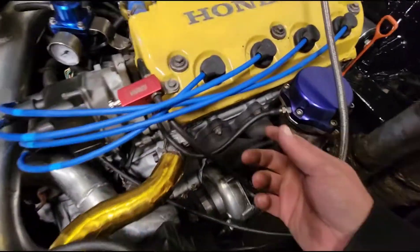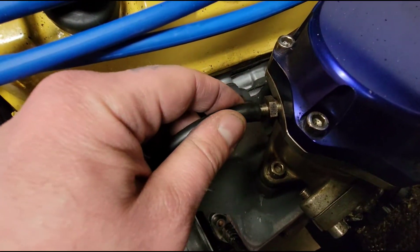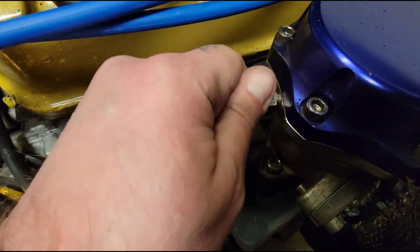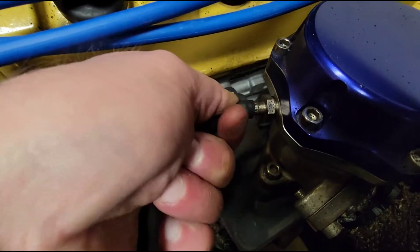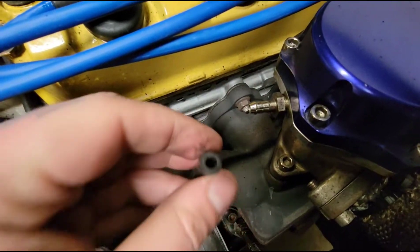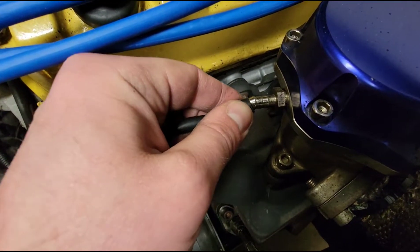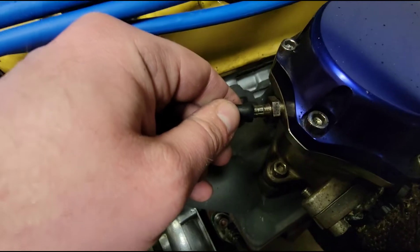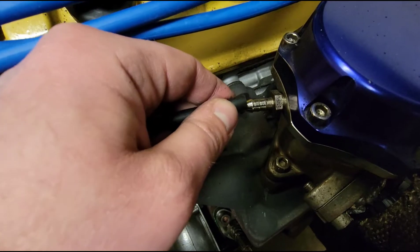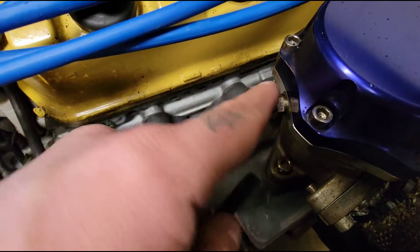Right off the bat you can see how this line is barely on and it's very easy to come right off. What you're looking for when you do these — I'm trying not to rip the line so I'm twisting and pulling on it. The rule of thumb for vacuum lines is you want them to go on pretty damn hard. See how easily that just went on? You should almost have to lubricate it to get it on so it doesn't come off, and then you should have some type of clamp — you can even use a zip tie — just something to hold it on firmly.